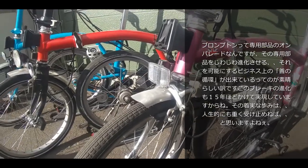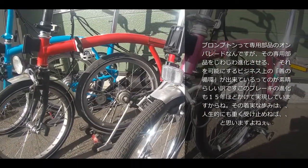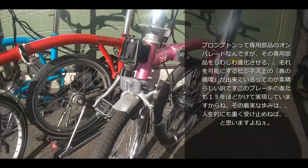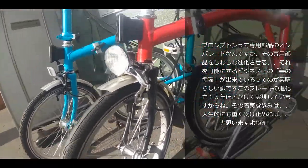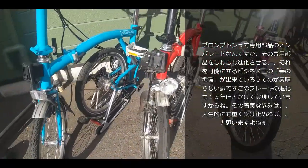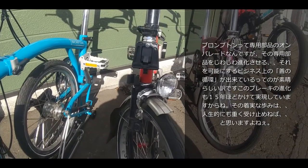The shift lever is now also mounted here. As for the caliper, the old Taiwan-model used a side-pull design with a single pivot, which transfers the least braking force via lever mechanics. Since the UK doesn't have many hills, a highly effective brake wasn't really necessary there. That said, Brompton freaks of the era often modified their bikes — swapping in dual-pivot calipers or Shimano levers. The current model's caliper, marked 'Brompton,' is essentially a dual-pivot caliper, and I personally noticed a clear improvement when comparing the Taiwan model to the UK model.